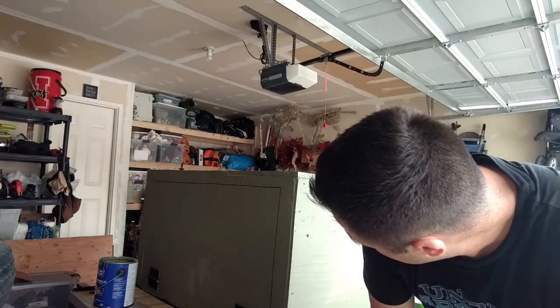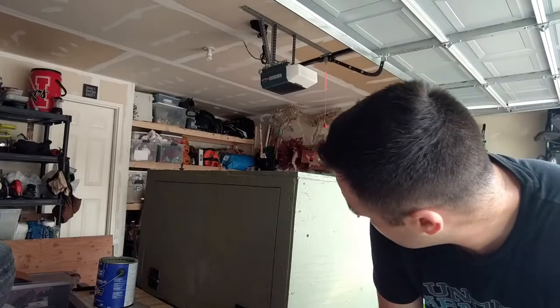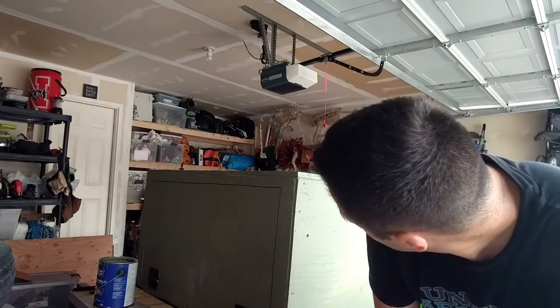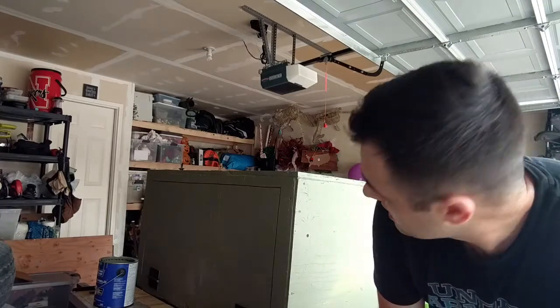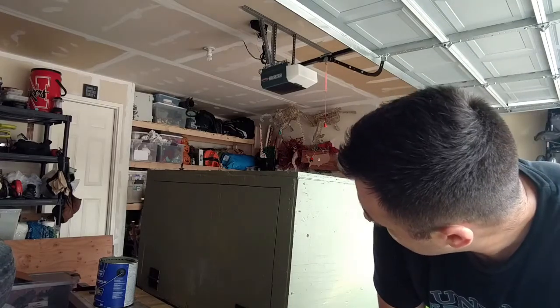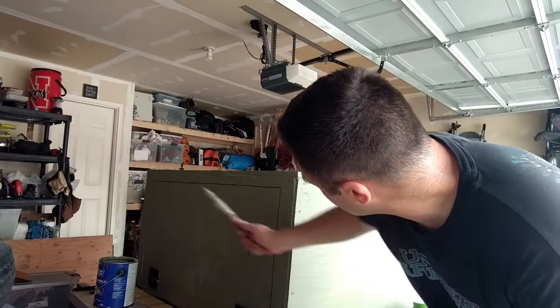Well, the trailer is now officially sealed, painted. I've got my black iron hoops and my Unistrut already painted and bed lined. So now those just need to be bolted on. I already got the holes drilled to be bolted through. I'm just going to run some silicone through there to keep it watertight. Then I just have to trim up my taillights and drill a hole through that so then I can run my wires through, mount my license plate. That cost me $12.80. So I also got some trim to go around these edges because they're not the prettiest. That's not the prettiest cut.